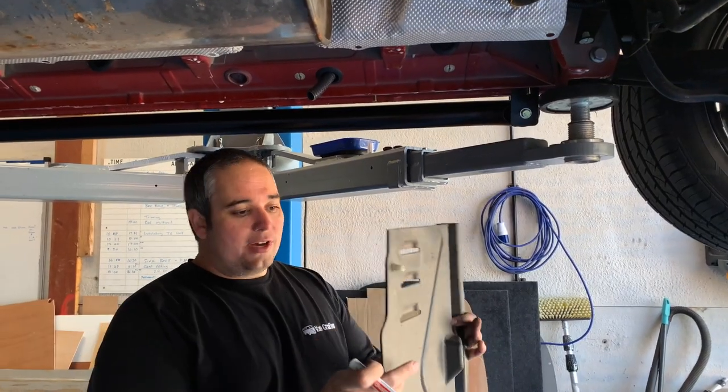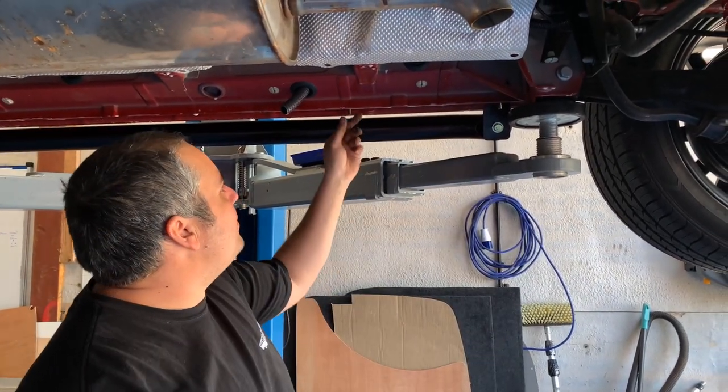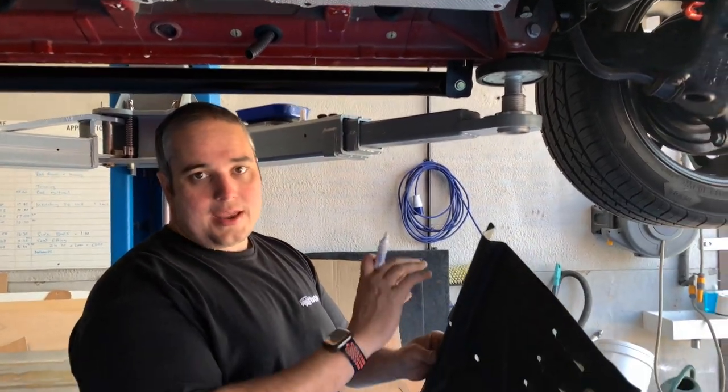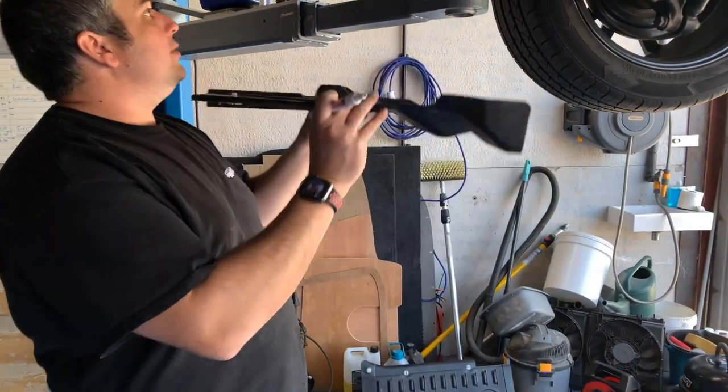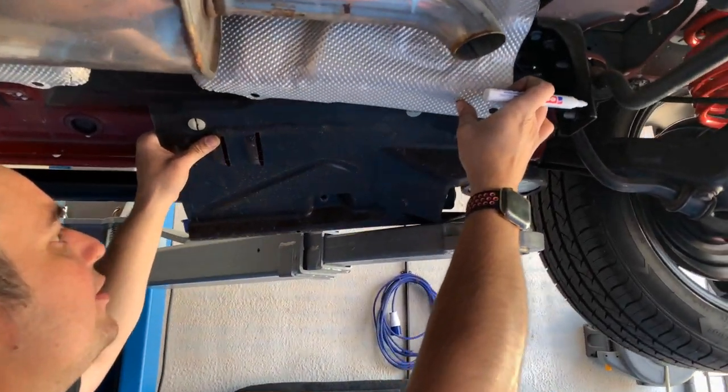So when it comes to fitting the under trays, we want to be putting those back into position where they came from. And we're going to have to mark where these studs are at the moment on the under tray, so we can mark those off and then cut out where those studs are going to have to go. So get that back into its position